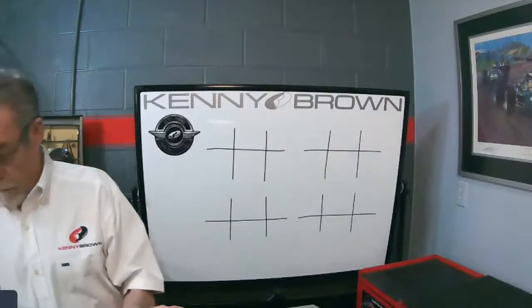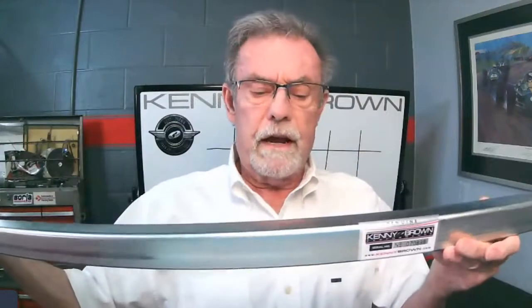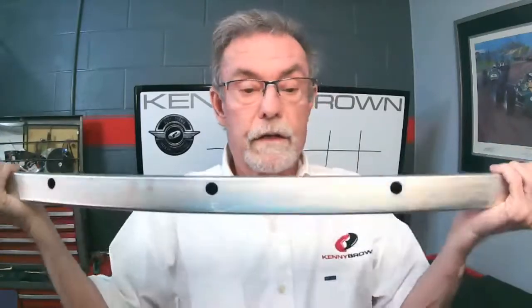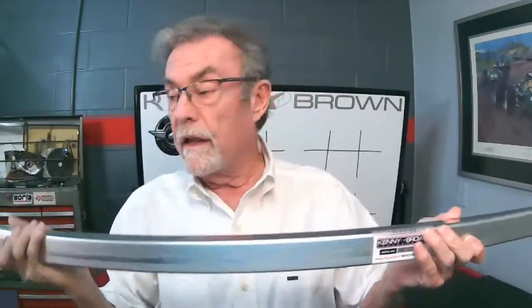But for the SN95, because the pinch welds are a little different, and they've got all these little darts that come through, we had to do something a little different. I mean, we went to like an inch by inch and a half, and we have these holes on the other side, so the little darts for holding the body in place slide right into that, and you can weld that right up there. It's not quite as long, but equally as efficient. The other cool thing about the jacking rails is that once you jack the car up, you can put your jack stands underneath on the jacking rails, and the hole underneath the car opens up.